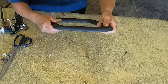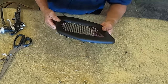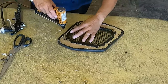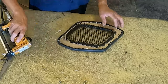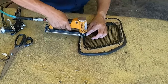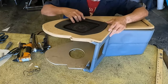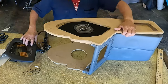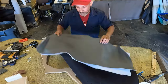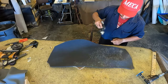I trim the excess material. This is heavy-duty vinyl — this black vinyl doesn't stretch at all. I got that piece done. Now trimming a little more. This metal will be right there. A lot of people hold that metal with hot glue or crazy glue — I always use a staple, and the staple I use is a quarter inch. Just make sure not to go through the wood. If you are using quarter-inch wood, whatever staple you use make sure it doesn't go through. I put them on there — you can start to see how it will look. I'm going to wrap this piece of wood with gray vinyl and add a quarter-inch foam for padding.